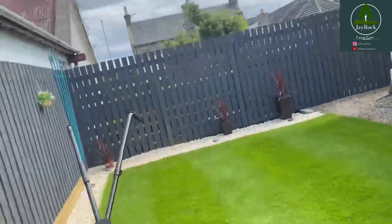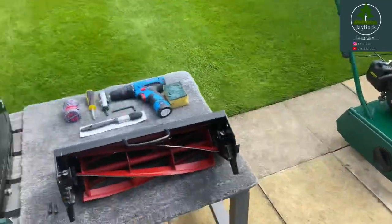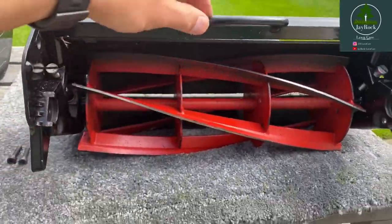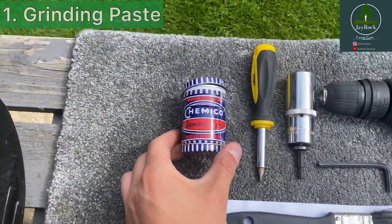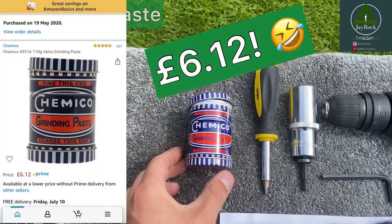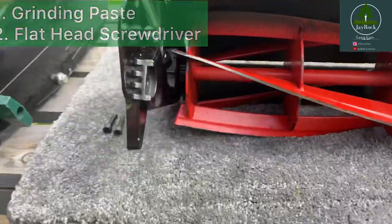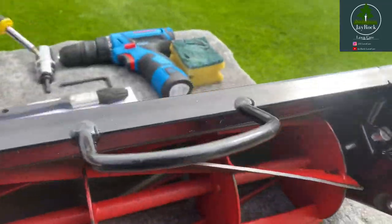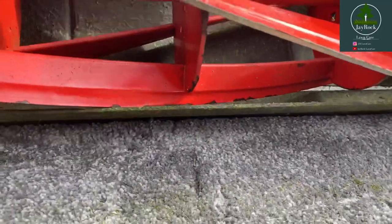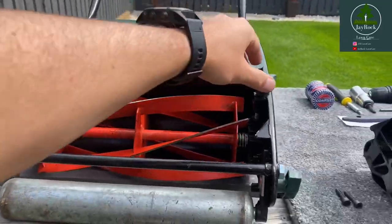Now that you've stripped down the cylinder, we're going to go through the equipment that you need to complete the back lapping. We've got both a manual mower cylinder and also my Suffolk Punch petrol mower. The tools we're going to need are grinding paste - I got this from Amazon for about £2.97, I'll stick a link in the description. You need a flathead screwdriver that's going to go under these tensioning bars to be able to bring the cylinder closer to the bed knife. The bed knife is at the bottom, and all it does is bring that cylinder down. On a manual, you'll already have these - there'll be some form of notches like this.